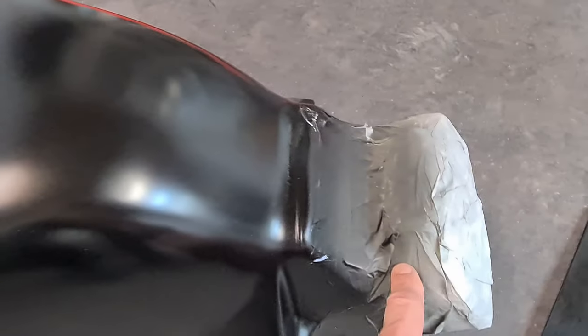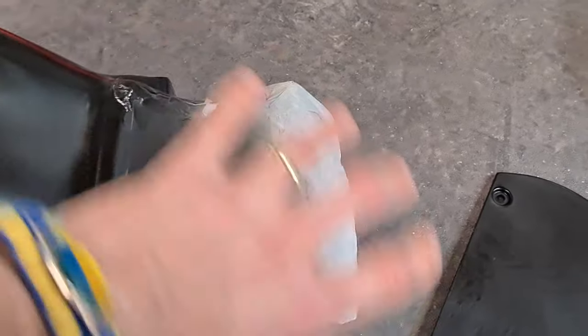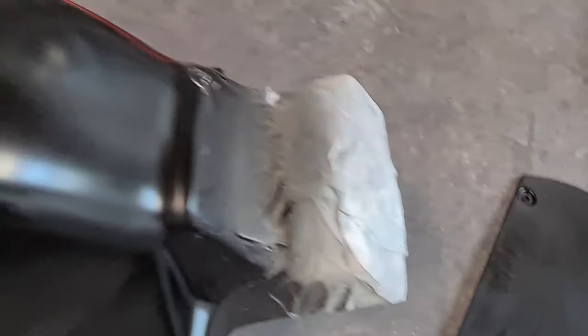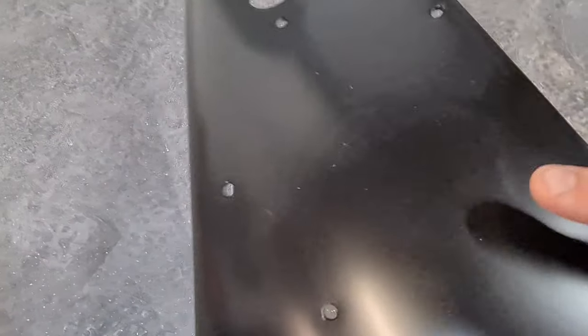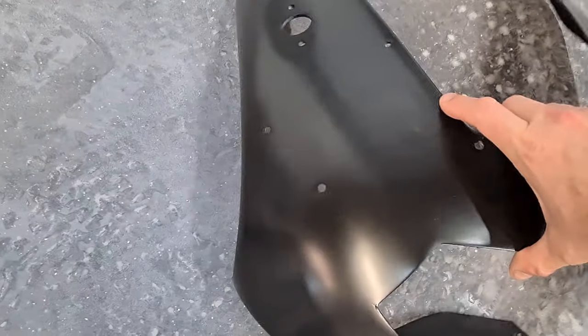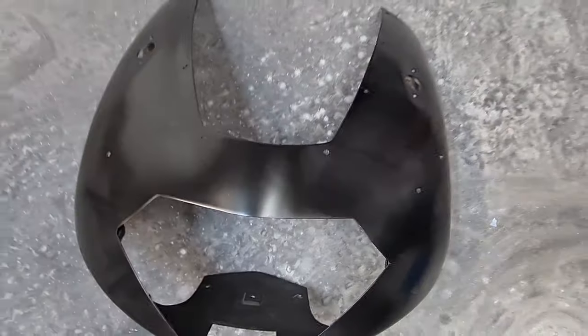I may peel this back — I don't know why that's been masked up from there, but underneath it could be all red or mis-coloured. So we'll take a look under there. That's going to get prepped. Nose cone as well — some prep to do on the nose cone. It's a lovely paint job on here but there's a few little scratches and niggles I've got to get out. There are a few little chips and dents in there — if I apply the decal to that it will show through and create an air bubble, so you need to look out for those.